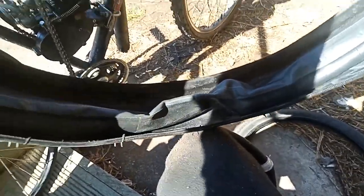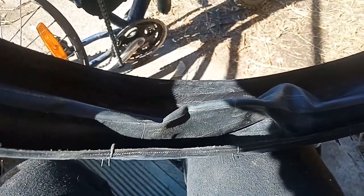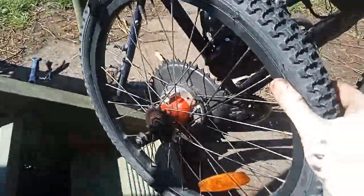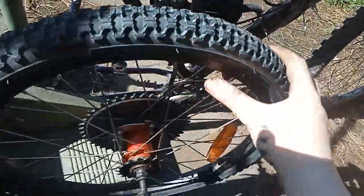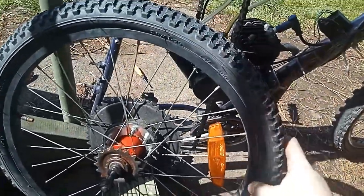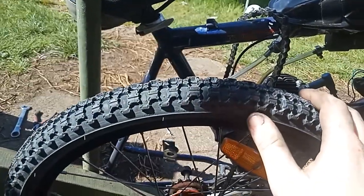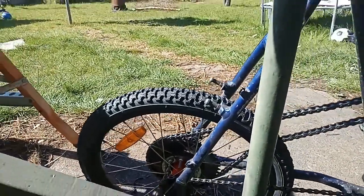I've done one layer of that cloth tape — it is fairly thick tape, you don't want it too thick because it'll start impacting the seat. All you need to do is put a few puffs of air in to get the tube to take a circular shape, not too much air or you'll pop it. You want it to seat into the tire as well as possible with no kinks. Then just give it an eyeball to make sure the bead has seated evenly all the way around the rim before putting it back on.